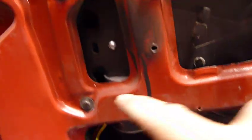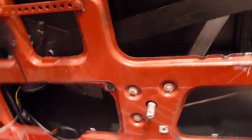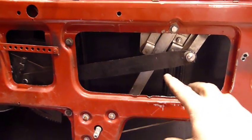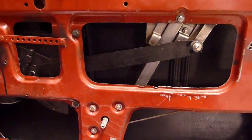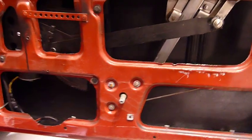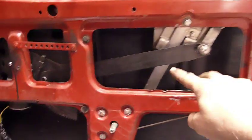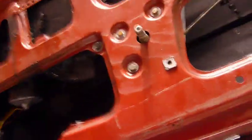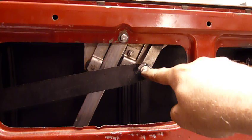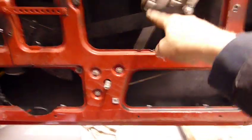Here's the regulator here — this is a pain in the butt to get out. To get it out, this arm needs to be straight right here. So if you have to take this out, it took me like an hour or two to figure out how to get this thing out. The first thing you do is there are two bolts, and you can loosen up the window. I put a suction cup up on the window, and that holds the window in place. Then you take out the 10mm bolt here at the top and the 10mm bolt at the bottom, and then you take off the screw here. That allows the part that actually runs the regulator up and down to come out.